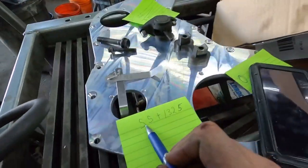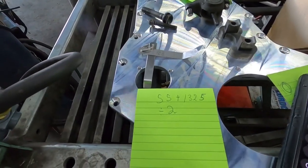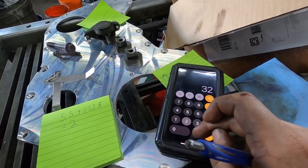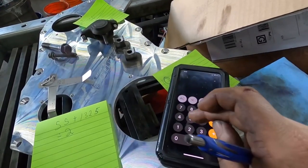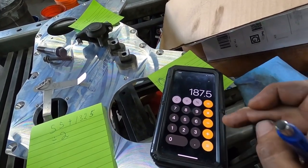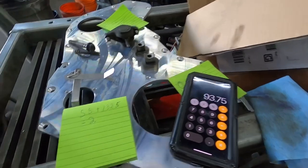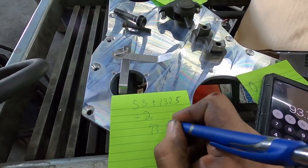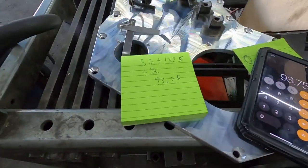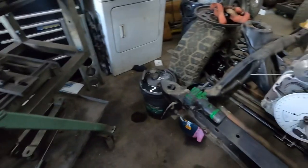What you do is add your first number to your second number and then divide by two. So 55 plus 132 and a half equals 187.5, divide by two - we're at 93 and three quarters. For a Colt Stage 4 camshaft, the intake centerline spec is 93 and a half, so that's within a degree or so and I'm happy with that for what I'm doing.